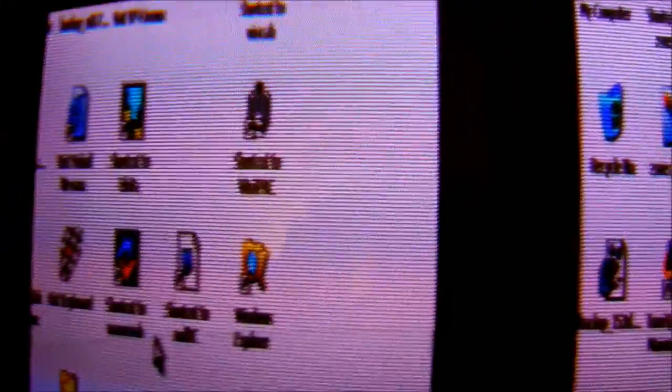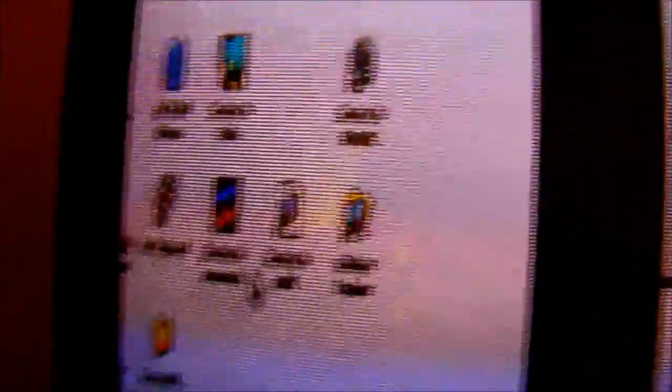The first image is my Sony TV displaying the Windows XP desktop. This is connected using an Arcade VGA card. You'll notice the screen is split and not displaying correctly — this is because it's an interlaced image at this resolution and the geometry needs adjusting. I'm not going to change all the geometry just to display the Windows desktop, but this shows the Ultimate SCART Adapter is working as it should.